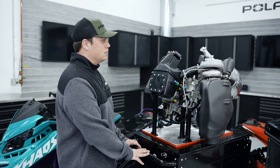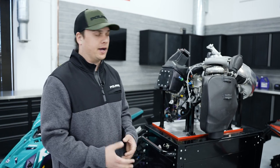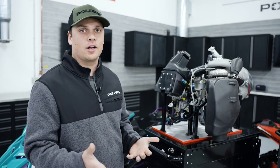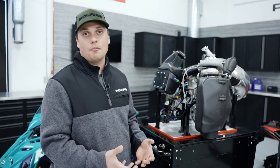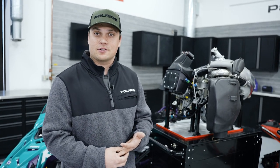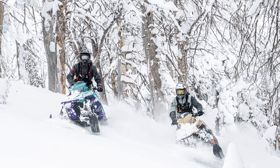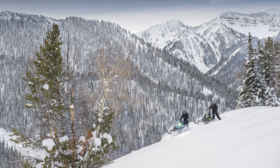When we look at the Patriot Boost system itself, the magic is what we call Smart Boost — it's all about seamless control every single day, every single ride. The external wastegate up on the tune pipe is what makes Smart Boost work. It unlocks a new level of combustion stability and allows us to pull a lot more power and smooth control out of the engine. At 9 PSI boost up at 10,000 feet, at sea level it makes 10% more power than an 850 Patriot. We boost all the way up to 10,000 feet and deliver 50% more power than an 850 Patriot does at that altitude — in our RMK lineup, that power high in the mountains is just incredible and unlocks new terrain.